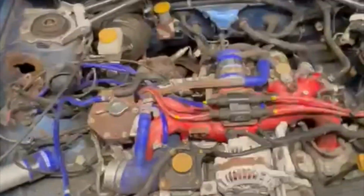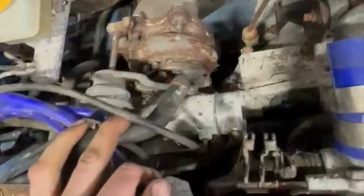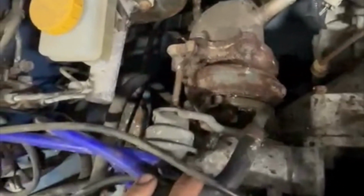Anyway, carrying on with it then, I think next I'll probably take the starter motor off and a few of these top bell housing bolts. I'll probably try and take the manifold, the downpipe from the turbo off and see if them bolts want to come free. It looks like an aftermarket exhaust, so it looks like it'll probably be alright. And it looks like there might be some bolts missing on it anyway, so all good fun. Let's crack on.